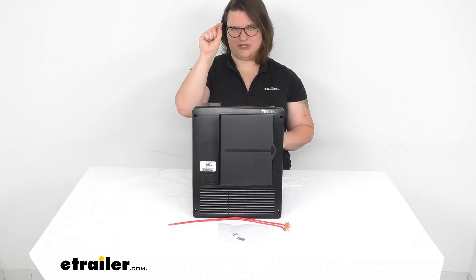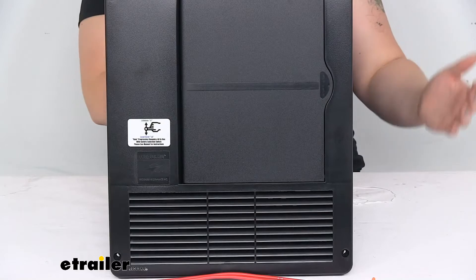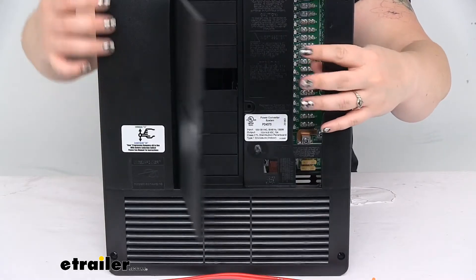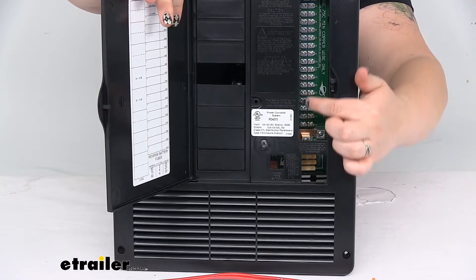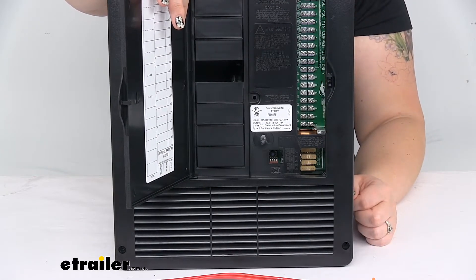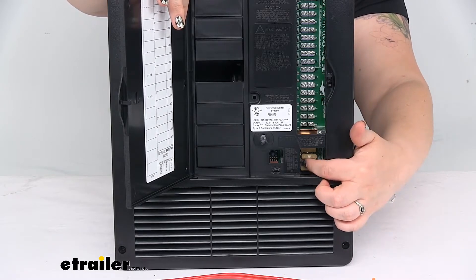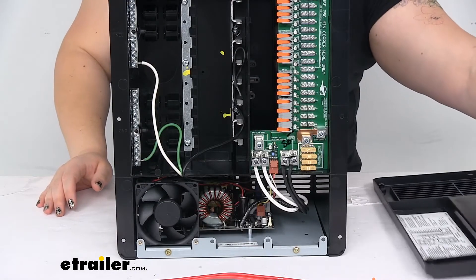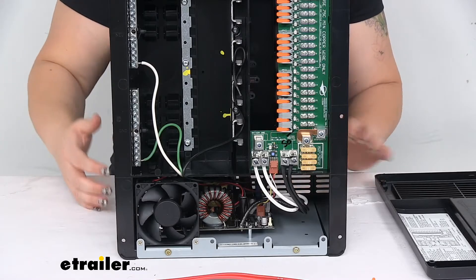Now there's just a little tiny switch that you have to flip to make that difference, especially if you're going to be upgrading your system from lead acid to lithium later on, so it makes it a lot easier. This is our front panel — it has that little push-to-open connection. We'll have all our connections here for our DC panel, and it's going to have automotive-style blade fuses so we can connect those in to keep everything protected. It does not come with those fuses, so you will provide those on your own. These down here are for the battery protection, so if you happen to cross your connections and accidentally connect the ground to positive or cross your negative to positive, this is going to protect your system so you don't have to worry about anything getting fried from that.